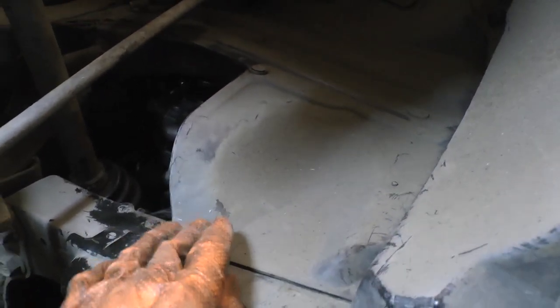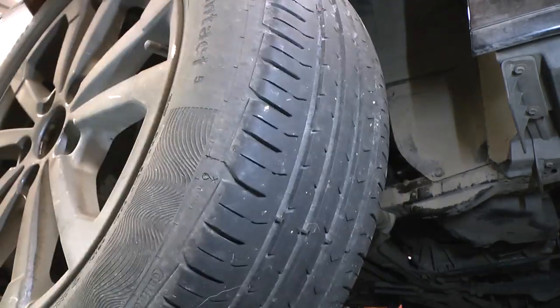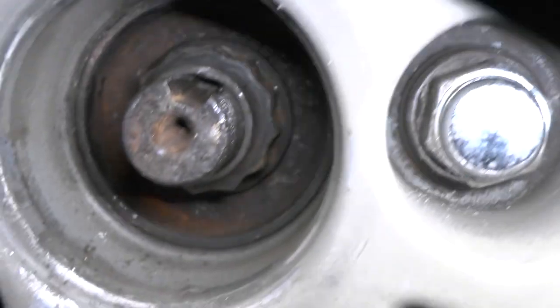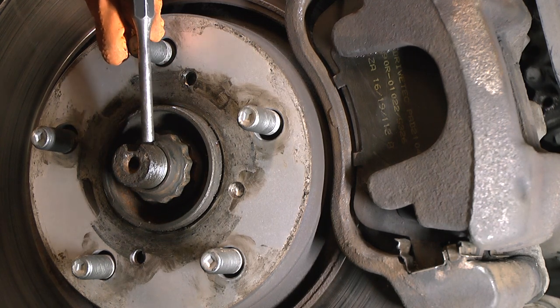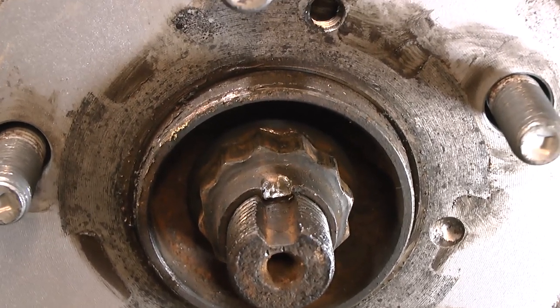Three, four behind there — all four bolts in place, and I've put in a brand new one at the top as well. I'm going to pop the wheel on and pop this center cap out so I can do the hub nut up after I put the wheel back on. The hub nut torque is 213Nm. I'm going to bash down this so it becomes like a locking nut and doesn't come off. That nut's completely secure now — on at 215Nm and bashed down.